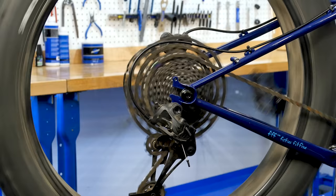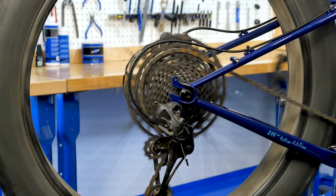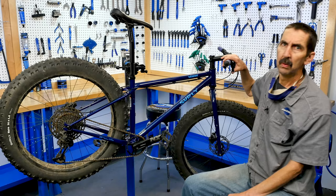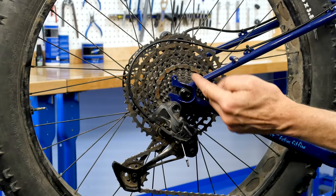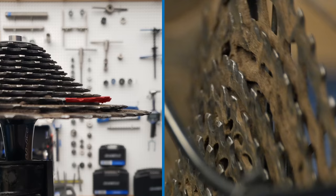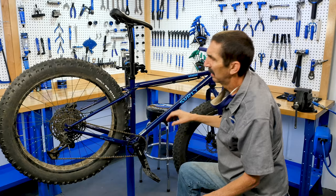Sometimes you've got to get off and have a closer look, so we have to dismount. We have a look, we shift up — is it ugly. We go slow and we see that lift. Twice. We go in one more cog — it sits there, but it's more subtle. We do have a little bit of clanking. This one? Horrible. What's going on is a problem with the sprocket, the one that we're on. As a mechanic, you've got to remember two different points of view. It's nice to come in and look this way — you can see the chain hopping. But we're also going to remember to change our viewpoint, come down on it at another angle. We can see that one looks bent — badly, badly bent, right here and again here.